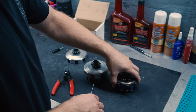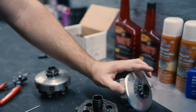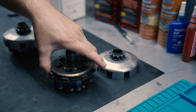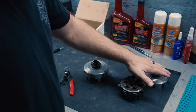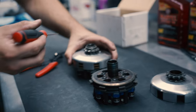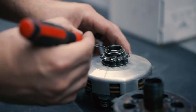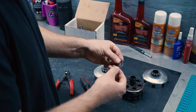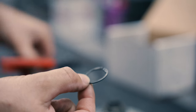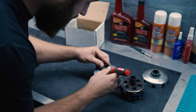This is what the inside of it looks like, and this is what the drum or the bell housing looks like. I've got this one taken apart already, and then we'll take this one apart just to kind of show you. This one is the 11 tooth gear, so it uses a special spiral clip. Some of them use a little snap ring and you just use snap ring pliers to pop it off. This one uses a little spiral clip.